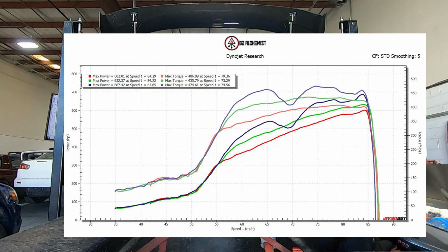With the increased boost level, the breakups are bad. I'm pretty much at the limit or recommendation of the ignition coil's dwell. I can try to increase it. I am going to in a little bit, but I'm really, really cautious about playing with ignition timing and dwell time, because you can fry the coils.